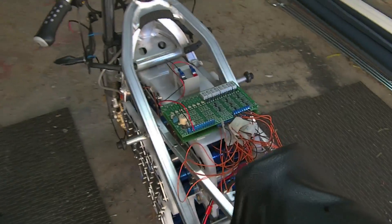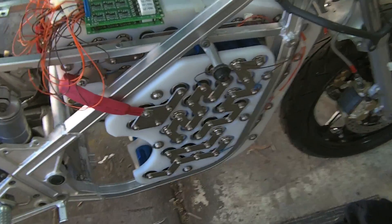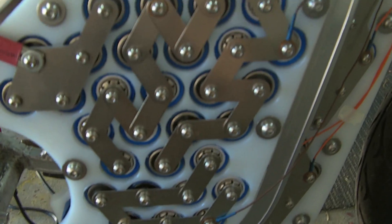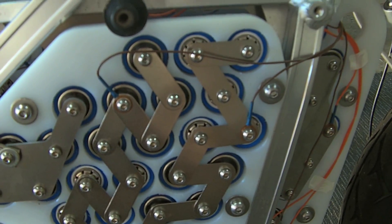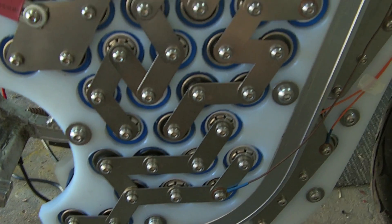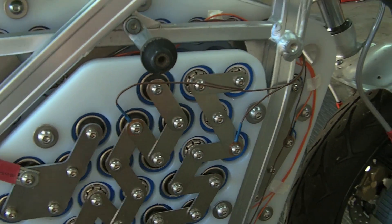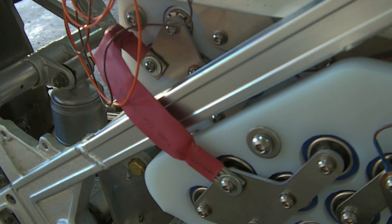Around this side you'll note that the outer pack — I still don't have all of the laser cut connectors, so there's a very temporary rig up here. This will only be good enough for me to charge the pack and to do a balance draw on the pack, so this won't do more than 20-30 amps — it may do up to 50 but nowhere near what I need. You can see the other connector here from the inner to the outer pack.